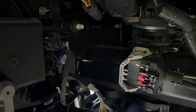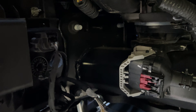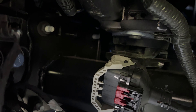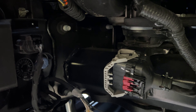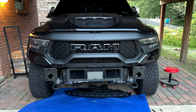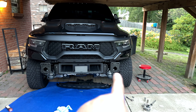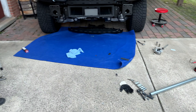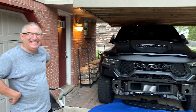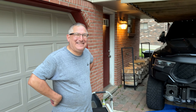Onto the nuts holding the bumper onto the frame — these are 18 millimeter. For the most part I can get an impact gun in there on two of them, but the one up there is going to require a wrench. We just got this bumper off, and those inner bolts were no joke. We had a lot of tools, and my neighbor came over to help. He managed to get the bolts off when I couldn't — it's all about getting a good grip.